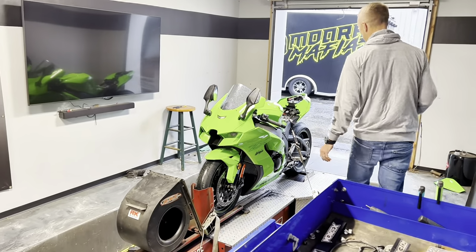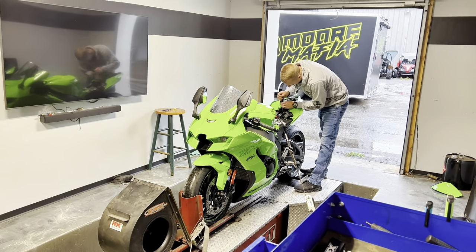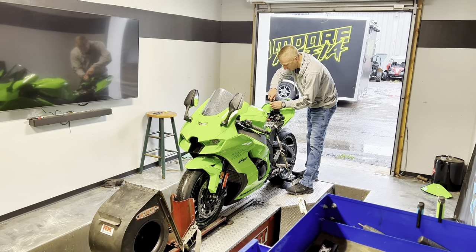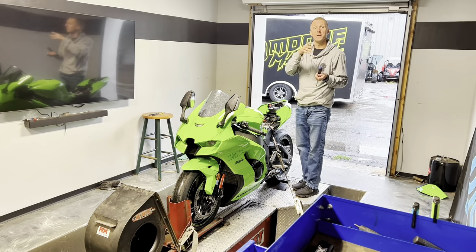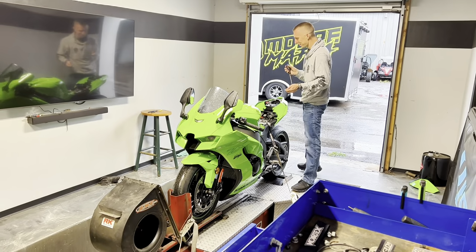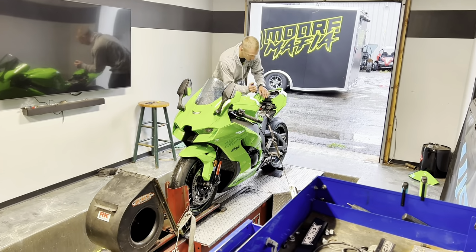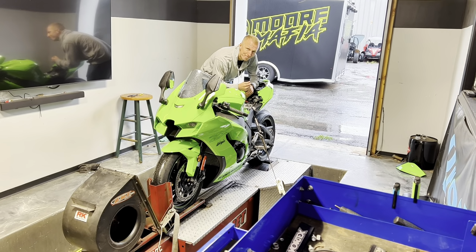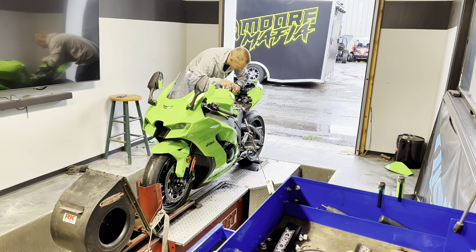Because I was coming down, I mean, we're going 145 miles an hour down to, like, 65 into a turn. I about lost it. Blipper jumping, and the reason for that is the fuel injectors are running, and now the throttle blips open. So what happens when you give it gas and you rev it up? Oh, it was, I mean, it's so violent. I almost felt like I was going to go over the bars. I wasn't expecting it because my R1s don't do that. None of my other bikes do that thing. None of them. Only this bike. Yeah, they suck when you do that.